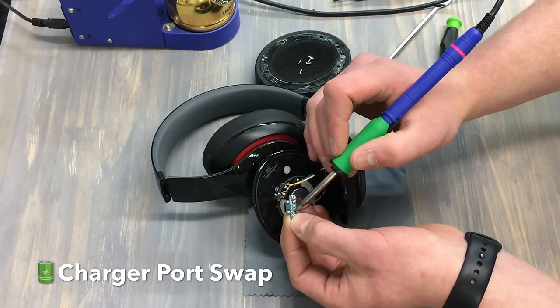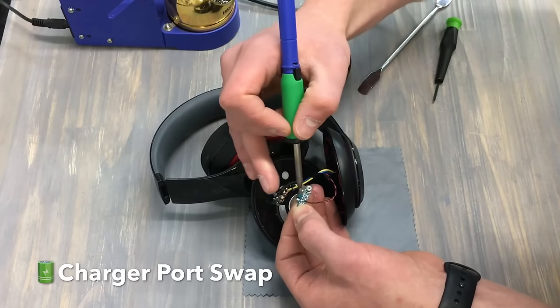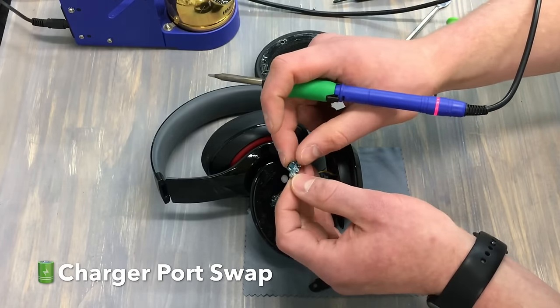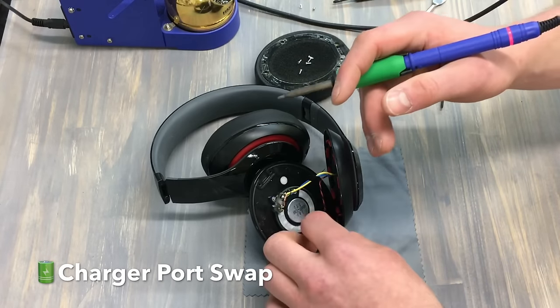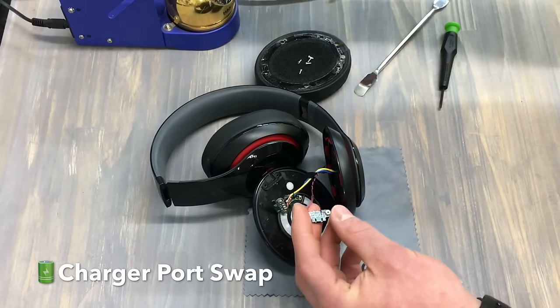Get the red point installed. It looks like it's a little bit low on solder on this pad here — I'm going to go ahead and just put it on there. The biggest point with these is just positioning the wires in the right place. You want to make sure you get them in the right place. Don't be applying a lot of heat — just once you're in the right place, quickly tap on there, get that solder going and you're on your way.